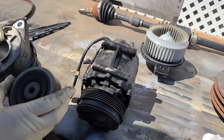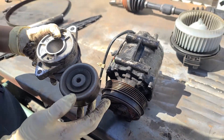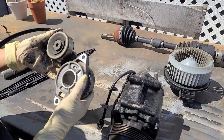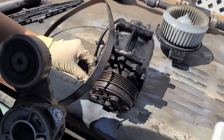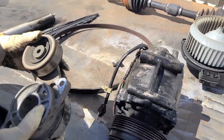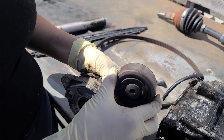And then this is another rattle — what is that? This is your drive belt tensioner. This is how we're able to get the drive belt on. The drive belt runs your AC compressor, your alternator, power steering, water pump — it runs like everything. This was bad, it was pretty noisy, and it was loose with a good amount of play in there.